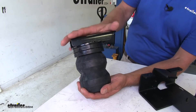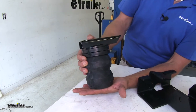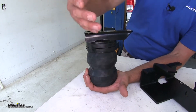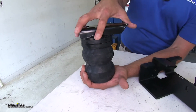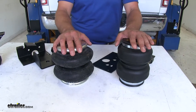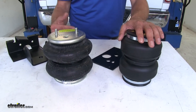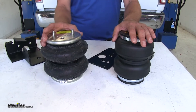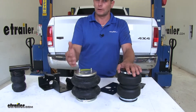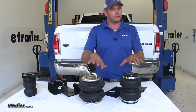With the Timbren style spring, just like all the other upgrades, this replaces the existing factory jounce bumper. It comes down to the jounce stop, and depending on the load, that's how much pressure you're going to be supporting. This doesn't allow for vehicle leveling. The big benefit with air springs is that we do have the ability to level the truck back out. When we return the truck to level, we're getting all of our factory settings back — the headlight angle, where they're pointing, the suspension geometry — all those things are going to be back to normal.